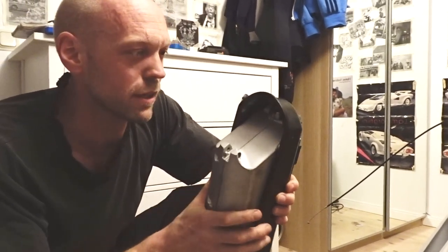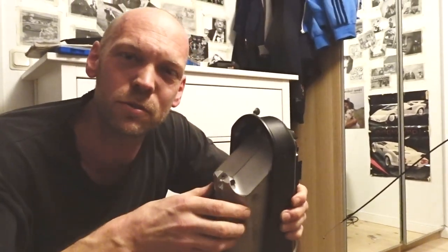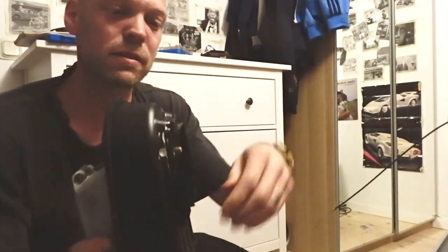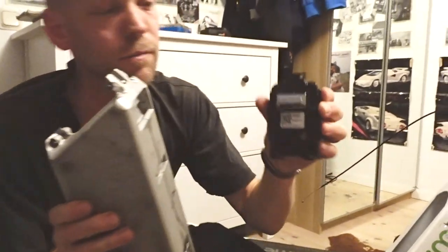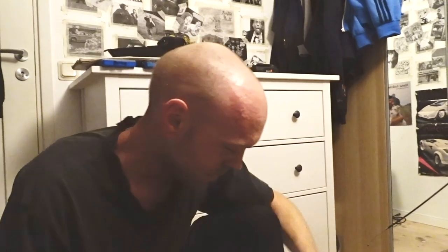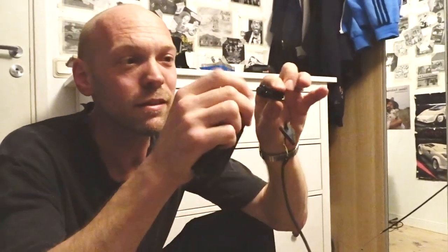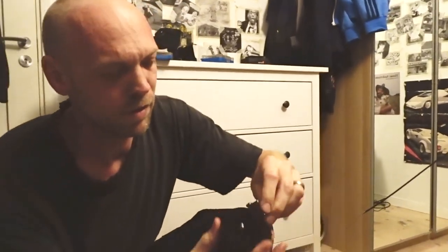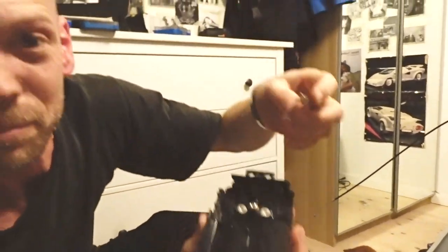How the battery is locked into the holder is pretty intricate — it's a very sturdy thing. You cannot just take a crowbar and try to bend it open; everything in this scooter is very well done. Down here you have a little lock that opens the release. I would have guessed they used a simple solenoid or magnet, but no — it's much more complicated. They have this little servo motor that pushes a cog wheel.